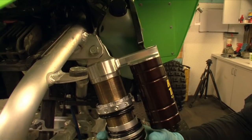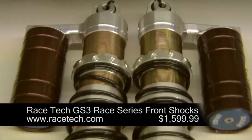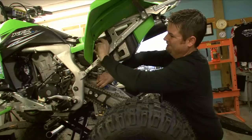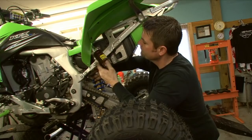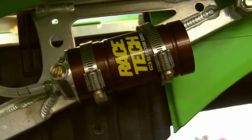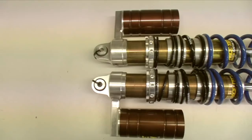While overspending on your engine can be a mistake, it's hard to overspend when it comes to suspension. Racetech's suspension components are some of the highest quality in the industry. Our Racetech GS3 shocks feature 46-millimeter zinc-plated steel bodies and chromed 5/8-inch steel shafts. Most remaining components are constructed of aircraft-grade aluminum, while the eyelets feature stainless steel spherical heim joints. The internals are comprised of Racetech's famous gold valve, developed to prevent oil restriction at the piston, helping prevent high-speed harshness. Custom valving and spring rates are selected based on rider weight, type of riding, ability level, and specific chassis setup. For our Texera arms, Racetech built us 18 and 3/4-inch long front shocks and a stock-length 17-inch rear shock. The Zero Preload Race Series GS3 shocks feature high and low speed compression and rebound adjustment.